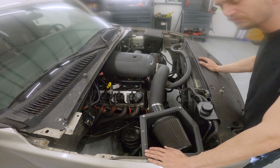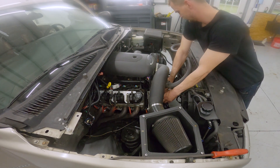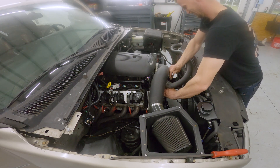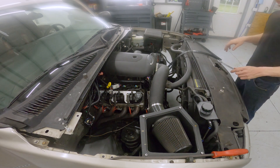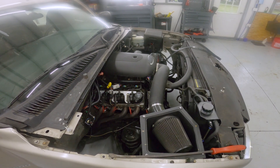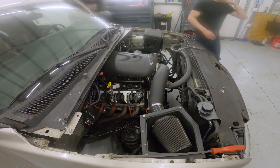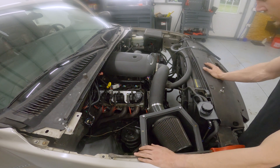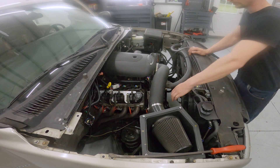What I'm gonna do is go ahead and cut it off and pull the serpentine belt off and see if the noise goes away. All right, let's fire it back up and see. She's going away with the serpentine belt off — that's at least good news. That lets me know it ain't nothing internal to the motor, so that's a big relief. Tensioner's tight.